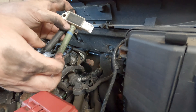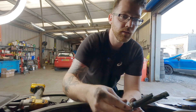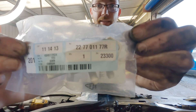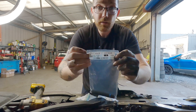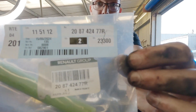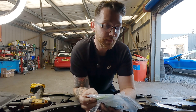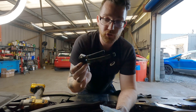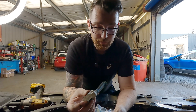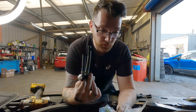That's why these need to be replaced, and we're not getting any reading from this sensor. Being as we've had to remove the sensor to replace these pipes, we'll replace this sensor as well. These are the broken pipes — we've managed to get that other broken piece out. The replacements are all sold separately, so I'll give you the part numbers for the sensor, for the black pipe, and the green pipe. What's going to be easier is if we assemble this together first and then press those pipes onto the hard lines underneath. The pipes are different lengths, so you are going to have to match the original.